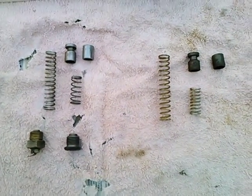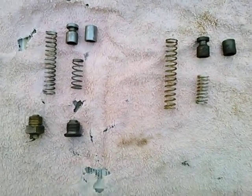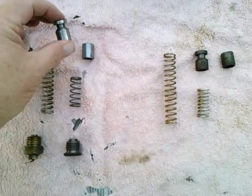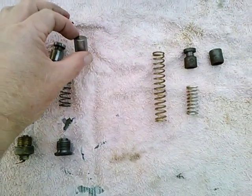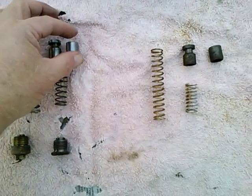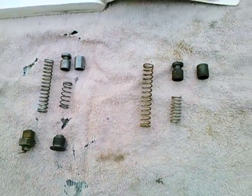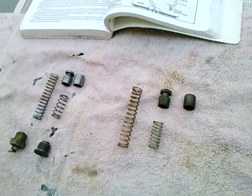I'm taking a look today at dual pressure relief on air-cooled Volkswagen. As part of my oil change, I wanted to make sure these plungers weren't stuck in the engine case, and both of them came out with the use of a magnet, so they weren't stuck. While I was in the neighborhood, I thought I would make a comparison with some aftermarket springs.